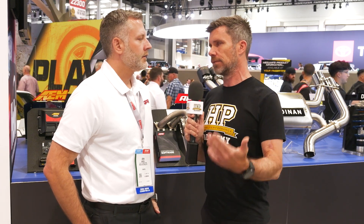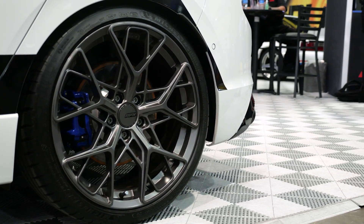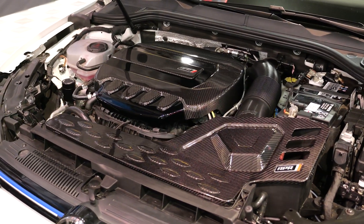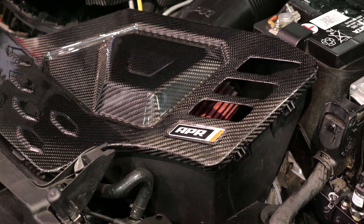Even on engines that aren't spread across multiple platforms at different power levels, OEMs leave a safety margin because the same platform may be going to countries around the world operating in different atmospheric conditions — mainly temperature. It could also be running on a range of different fuel octanes depending on what's available in each country. They tend to tune to the lowest common denominator, which artificially limits power if you're running on really good fuel. So if you tune for your specific fueling conditions, usually there's a bit of power you can extract.